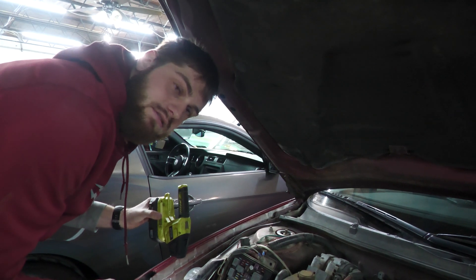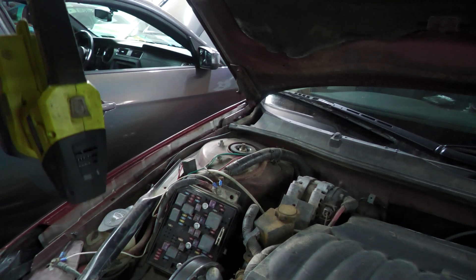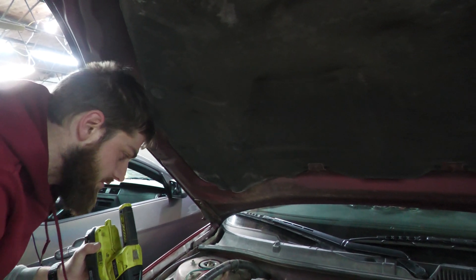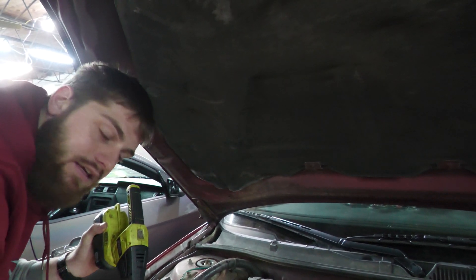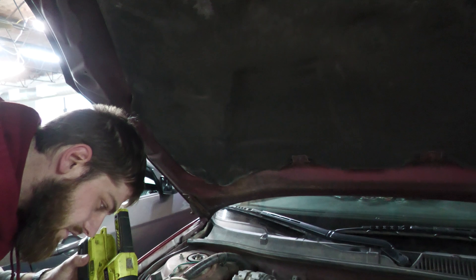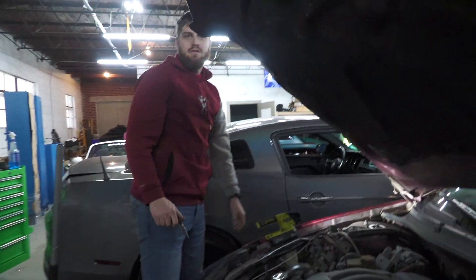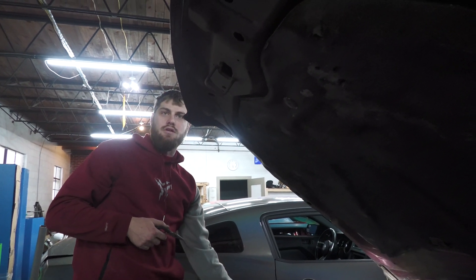So we're here at the fuse box — this is the main fuse box in the engine bay. That's where the battery goes; it's kind of tight down there. So what you do for a battery draw test is you have your meter hooked up in the back and you pretty much just pull fuses out and see if the current drops. That way you can isolate what circuit it's on and then narrow down — once you're on that circuit, you can check if it's your cigarette lighter or if there's a wire shorted out. So I'm just going to start pulling fuses and go back and check to see if the amperage has changed on the meter.